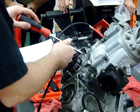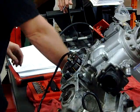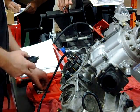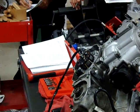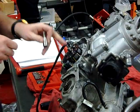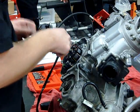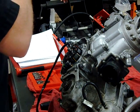You can get in here and try to see if it'll just come off with hand tools. If not, you want to use your impact again. And what did I always say I like to use? An extension on the bit first. I need to identify what size this is — most always your ignition plate bolts, the big ones that mount, are a number three. So you want to make sure you have a number three bit.